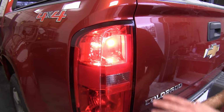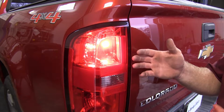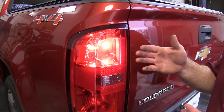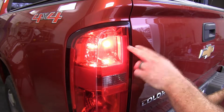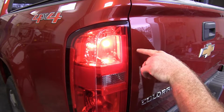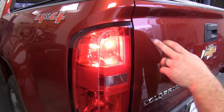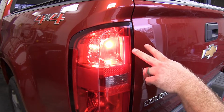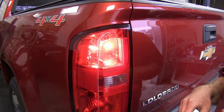As you can see here, we've got our left brake light illuminated, and that's illuminated coming through the 4-pole wiring that we added to this vehicle, which then runs to the diode that's behind the light here. And that splits the two signals, one from the wiring on the motorhome that's coming in, and the other, the vehicle's factory signal. It's going to take those and bring them out the same, so then you can just use the factory lights and not have to add any bulb and sockets.